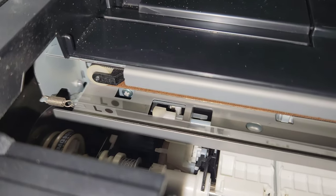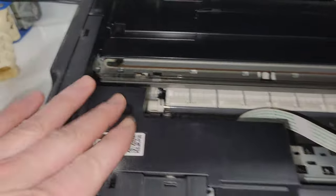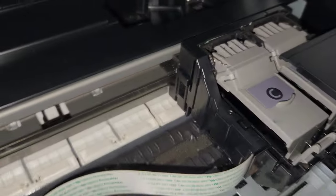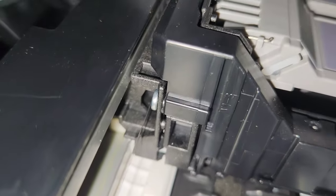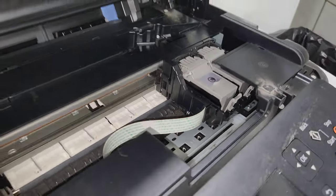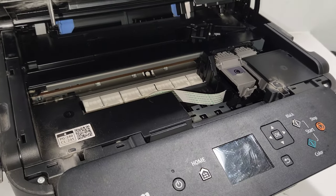On this particular model, if the strip comes off the hook, it's not much of a problem — you don't even need to remove any plastics. You'll just be able to reattach the spring right here. If that happens, make sure you connect it properly and that it goes into the right position by the sensor in the back of the ink carrier unit. Those are the key things to check to hopefully get rid of that horrible printing.